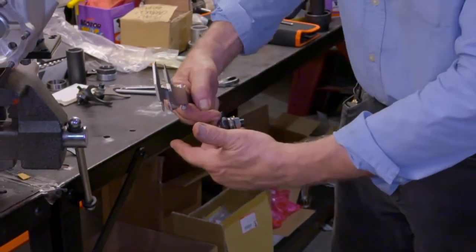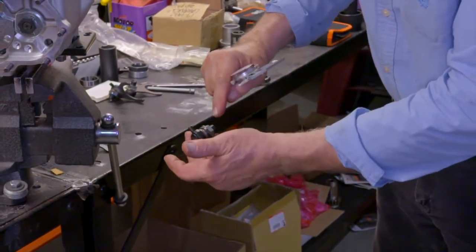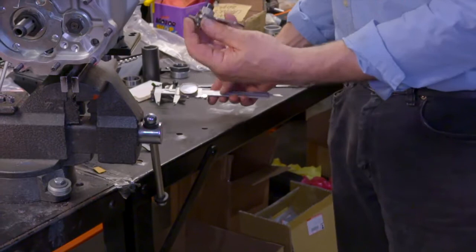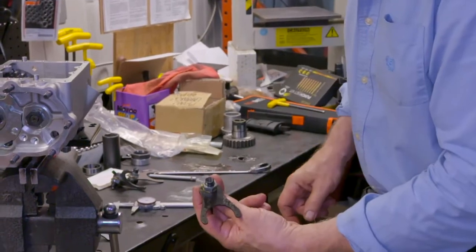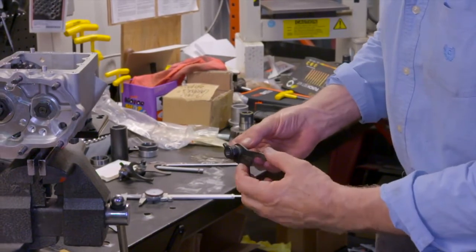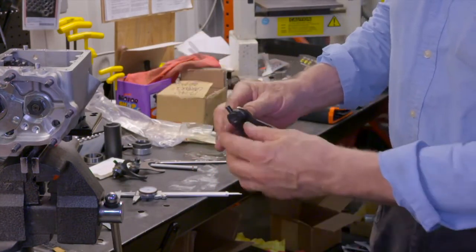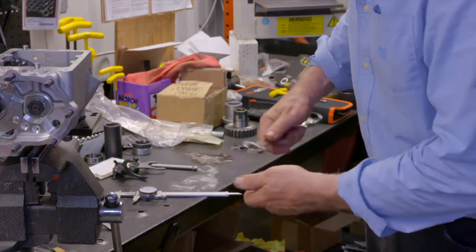That's the edge of the finger roller stud, the boss itself, to the outer edge of that jam nut. That's where I'm coming in. Now, the trick to this, we're talking now, of course, this is the main shaft assembly, the smaller fork. Now, the trick to this is, again, your finger roller with its spacing washer and thrust washers is running on the inside of the fork. There is an offset kick to this. So I'm going to break this loose and just give you an idea what to look for.